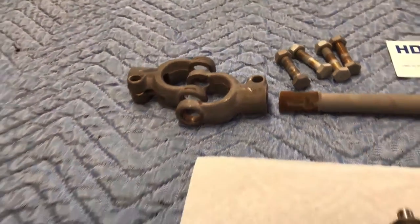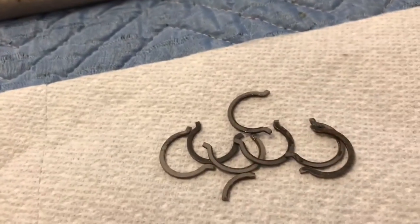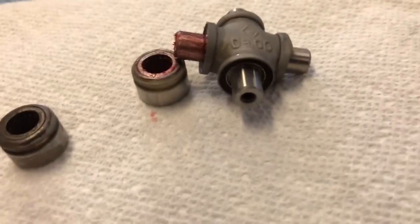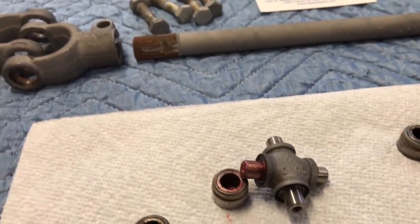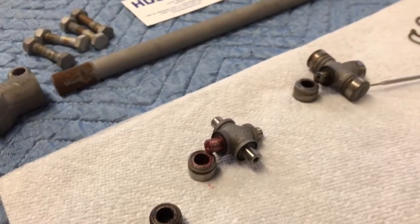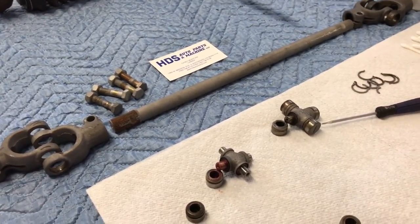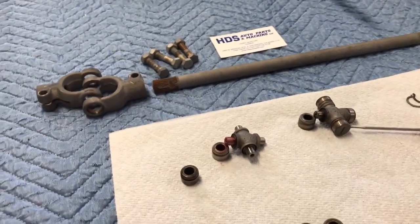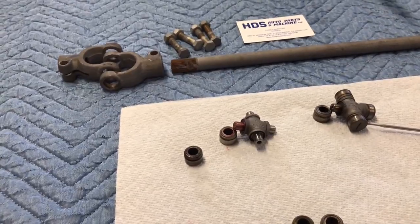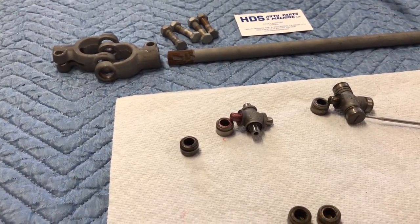The main thing is to be thorough. The only thing you're going to destroy in getting them apart is you're going to need some new clips for reassembly. And also these have a little rubber dust boot that will probably be sacrificed in getting them apart. However, I don't think this car is going to be seeing much dust for the remainder of its lifetime, so nice packing should give us really good action. I'm going to show you how to clean it in a gasoline solution without losing anything.